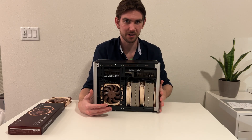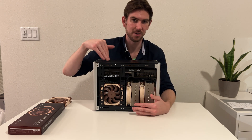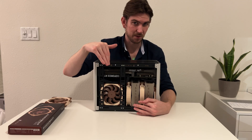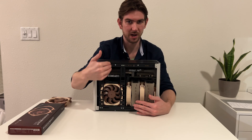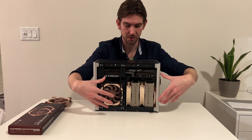You have cold air coming directly from the back through the cooler and then exhausting out, because the graphics card sitting here — all the 5080s and 5090s, even the 5070s if you have a triple fan — have a pass through, and it's going to blow hot air through. If it exhausts straight out, you're not going to be blowing hot air into the CPU cooler.